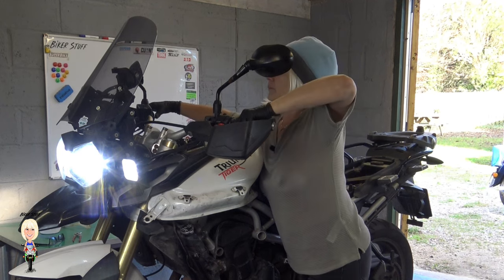It might be worth removing and cleaning the reservoir tank at this point. Sometimes the plastics can absorb the blue dye from the coolant and then it looks like it is always full. A bottle brush will help with this.